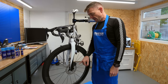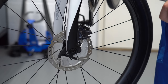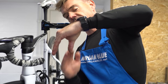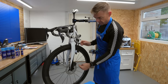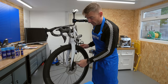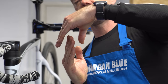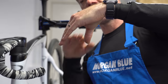The third reason is the rotor itself might be bent. If you've got a bent rotor, the whole thing appears to be in line, but as the rotor starts passing through the caliper it's got a wave in it. At some point around its circumference - it's kind of like a CD if anybody remembers what those are - it's actually got a crinkle in it. So as it's passing through the caliper, it's twanging on one of the pads.